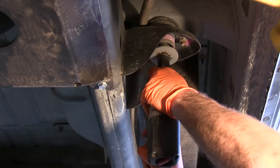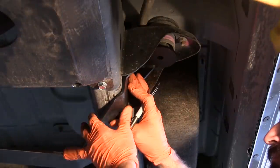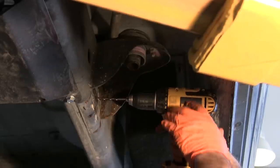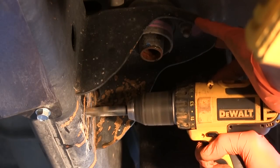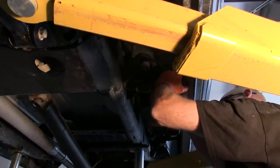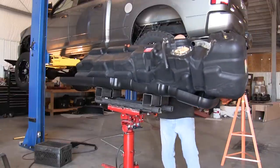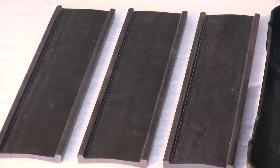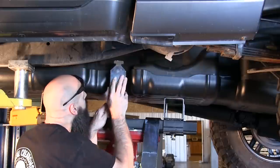This step concerns installation of the front tank support. It does not apply to the 7030303, so if installing that product please disregard these steps. Remove the driver side cab mount bolt. Hold the front support bracket in place and mark where the hole needs to be drilled in the frame. Use a small bit and drill a pilot hole through the vehicle frame, then follow up with a half-inch drill bit to finish the hole. If the optional Titan shield is to be installed, place it under the tank. If the shield is not to be used, install strap bushings on the straps and on the front support for the 56-gallon 7030210.